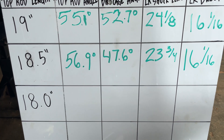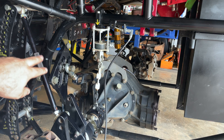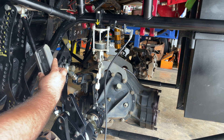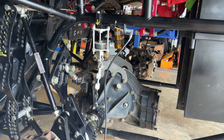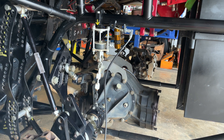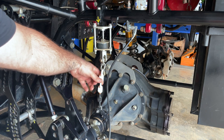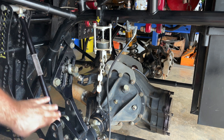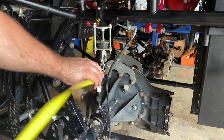Now we'll go to 18 inches and do the same measurements. This rod is now set to 18 inches center-to-center. The top rod angle is 60.2 — a pretty big change. And our birdcage angle is 39.8. Center-to-center on our left rear behind shock is 22 and a half. Here's something interesting: our chain has gone slack because now instead of hanging on the chain, we are hanging on this top rod. Our left rear droop is down to 15 and three quarters.